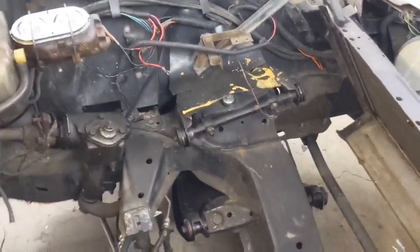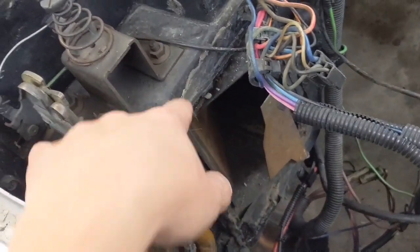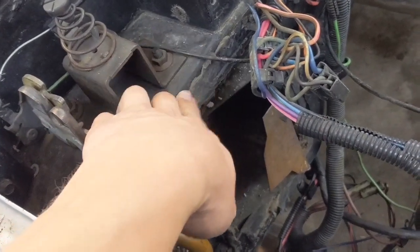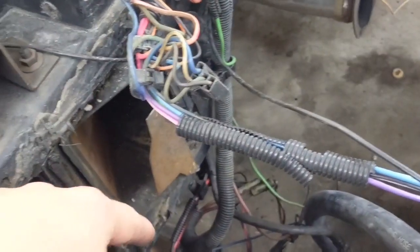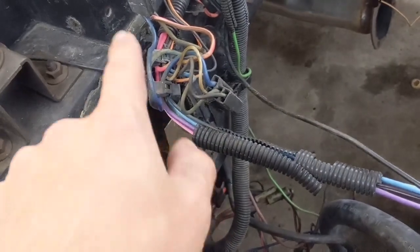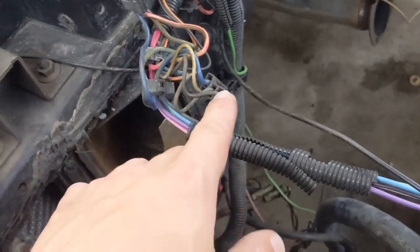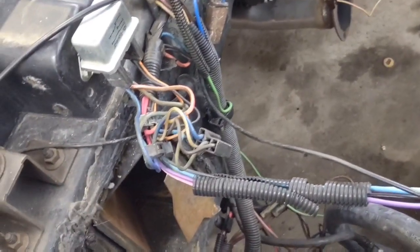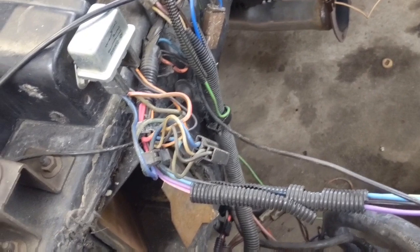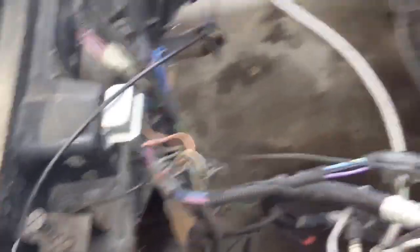This video is meant to be straightforward. You literally just bolt the new box back in. Mine had a couple of studs broken off, so I'm going to fix those, peel off the old gasket material, and re-gasket it. While you're in here, a couple of tips: check your heater core, check your blower motor and make sure it works. If you do replace it, I highly recommend the C4 blower motor conversion — it pumps a lot more volume of air into the cabin and is literally plug-and-play. Just order one for like an '85 Corvette and put it in. That's what I'm doing before I install this box.